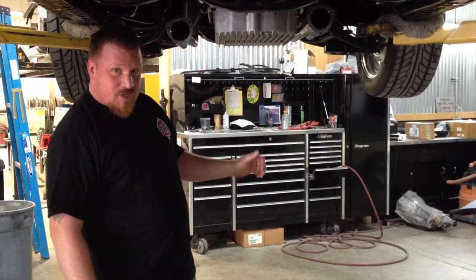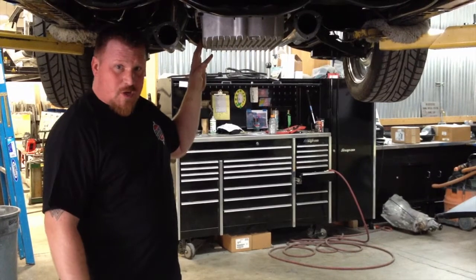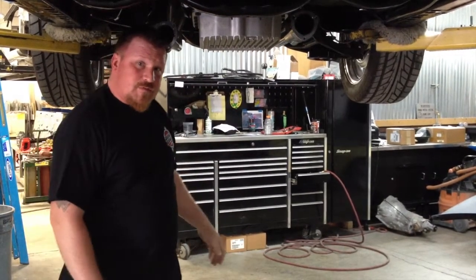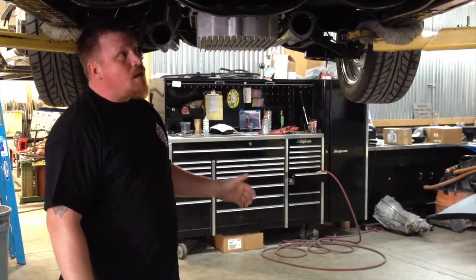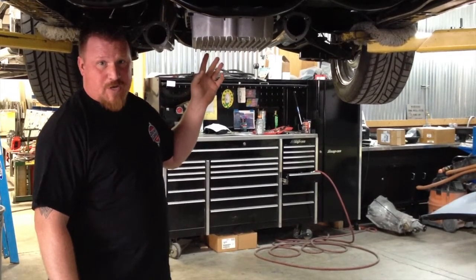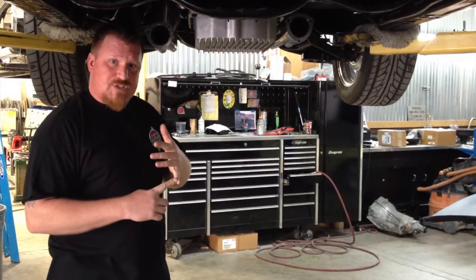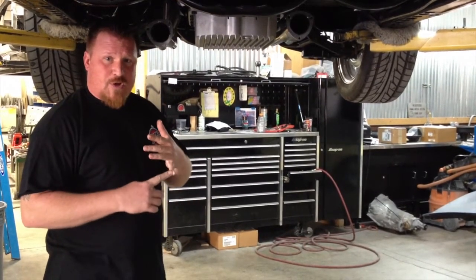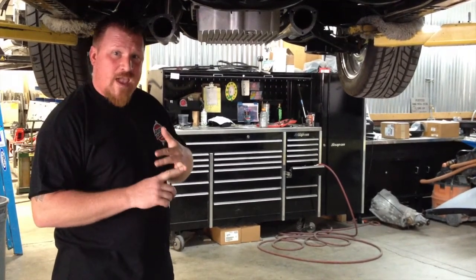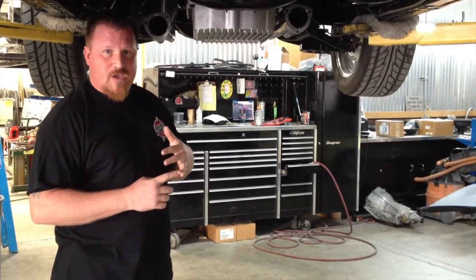Hi, it's Sean from Turner's Garage. Today we're going to talk about the Fuse Performance Transmission install we did on a 72 El Camino. We took out the factory-style turbo 350, which is a 3-speed automatic, and we put in a 4L80E electronic 4-speed overdrive transmission. This is not only going to improve fuel mileage because you gain the overdrive, but it's also a much stronger, durable transmission that can take horsepower of 800 plus if they decide to upgrade the engine any more than it already is in this vehicle.